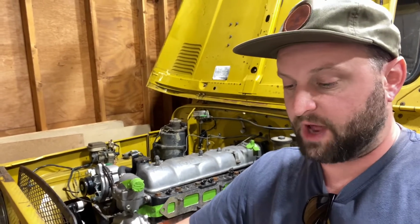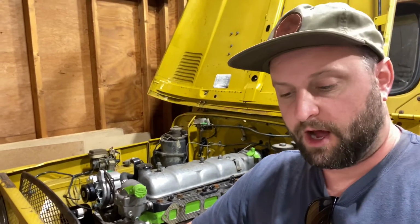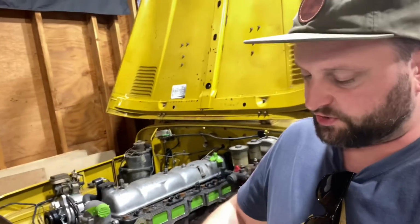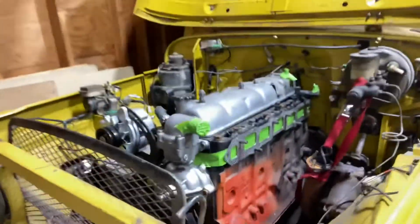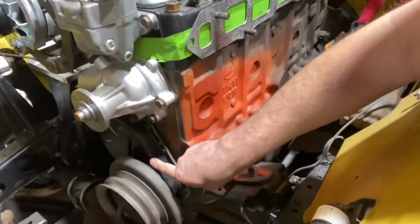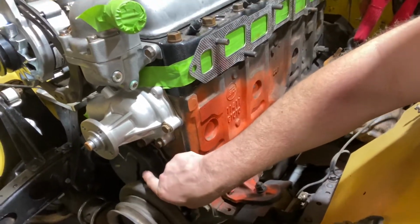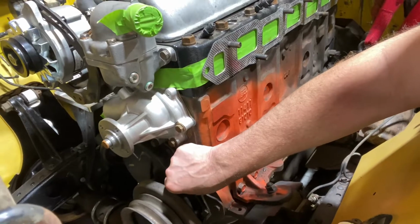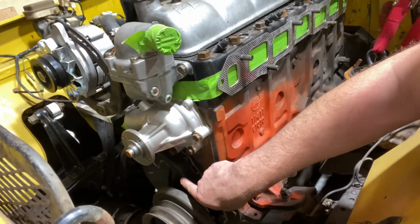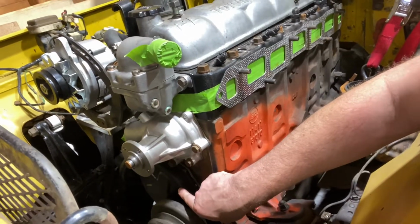85, we changed to a 3F head, and the 3F head gasket had better cooling flow direction. There was also a screw-in oil galley plug, and then the Torx screw hardware on the timing plate. Timing plate is deep down underneath here, and there's bolt-on, I want to say they're 8 or 10 millimeter bolts. They switched to a Torx timing plate, and those are still available from Toyota. If you're rebuilding anything, you need to just upgrade that. That should be something that's recommended.